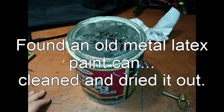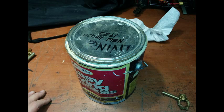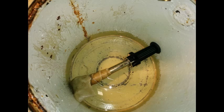I recently had my check engine light come on. I read the codes and got P0171 and P0174 indicating a lean fuel mixture condition. This usually means a leak in the air intake or vacuum system. I made this to find the leak.